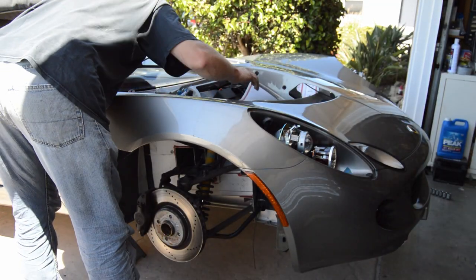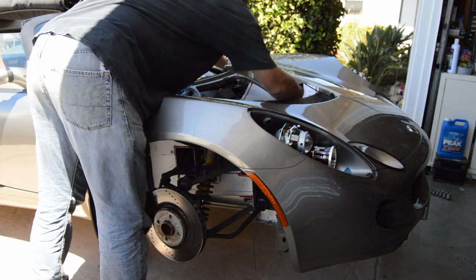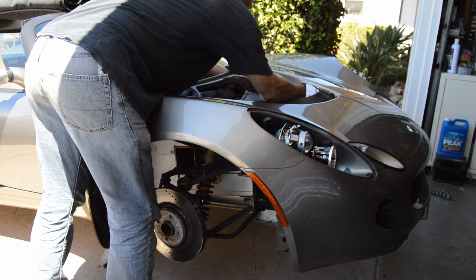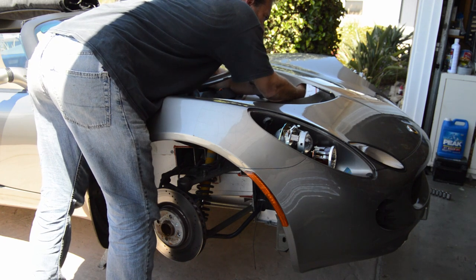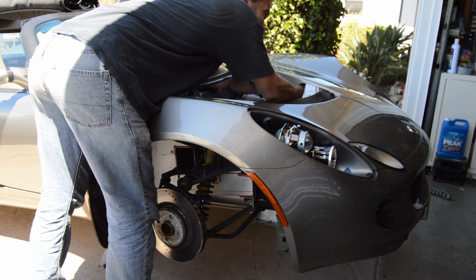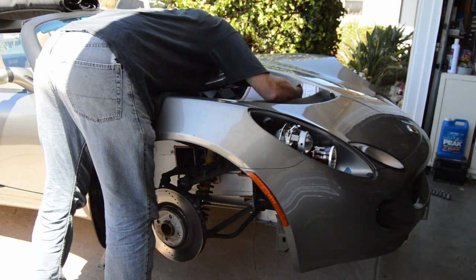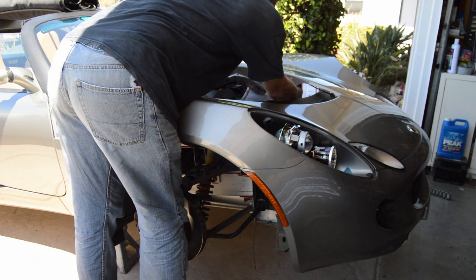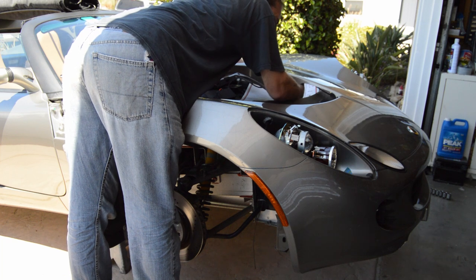What's actually going on now is I'm looking at the wire. This is the system antenna. It goes under this foam. As you could see earlier in the video, it was just scotch tape, basically like packing tape, up to the bottom of the fiberglass shell. It's got a connector that goes up through the center, and that goes under the foam piece that's like a divider between the radiator and the windshield, I guess. It's got a single connector there. You can actually leave the security system antenna in place and just undo the one connection underneath the foam block of the clamshell I was mentioning earlier, and it'll just come off with the shell when you remove it.